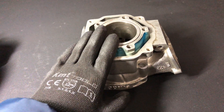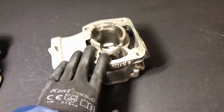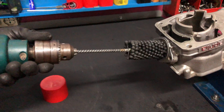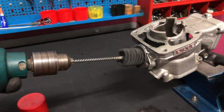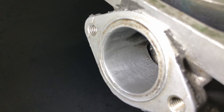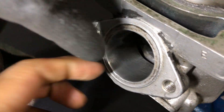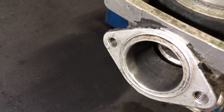The engine is not quite finished yet — we still have to polish the exhaust port. My dad is showing how to polish it right now. Compared to before, it's way more polished. You just gotta spend 10 to 20 minutes with this tool and you get your exhaust port polished. This is what you have to do once you finish building your engine — get rid of the rough edges.